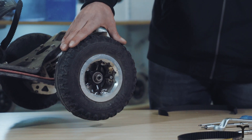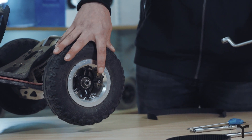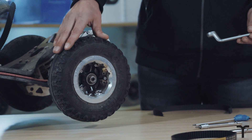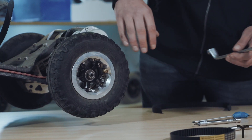The first thing we need to do is take this wheel off — you're going to need your 16mm spanner. Before you do anything though, deflate the tyre. The rim will need to come apart so if you've got any pressure in there it's going to pop out. I've already done this one, it's nice and flat.